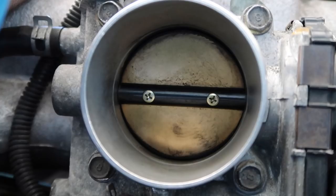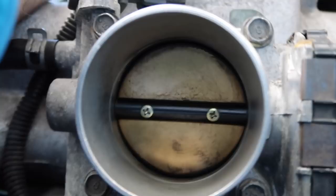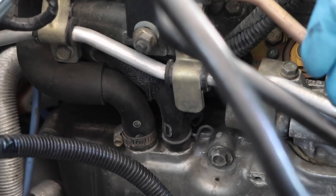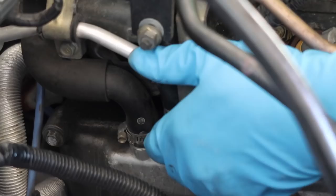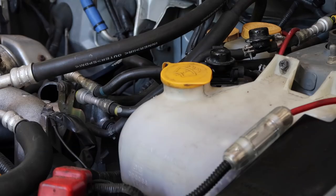One of the main reasons we're putting this air oil separator in: if you see all the oily sludge in there, that's all because we don't have an air oil separator on the car. Now that you have your top mount removed, go after the front hose — the front hose here is your PCV for the passenger side head. It's just a little spring clamp, which is probably loose, so you just squeeze that and pop it off. Work it off slowly but surely — that's your passenger side.